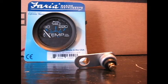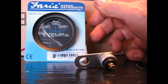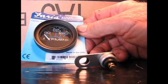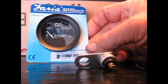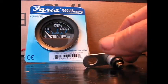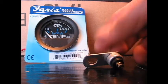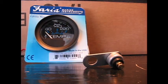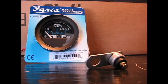What we're doing today is installing a temperature gauge on an outboard motor — in my case, a Yamaha 150. We're going to use a Faria Marine head temp kit, part number 13009. I got this on Walmart online for around thirty dollars. It comes with the sender, which bolts onto the head. The back of the sender rests flush against the head, and that's how you get your temp.